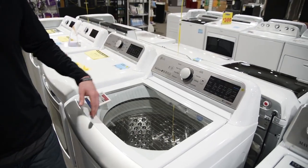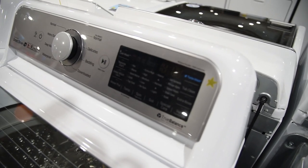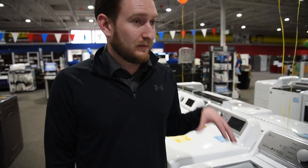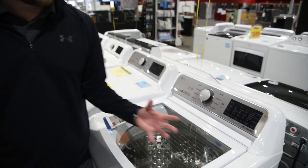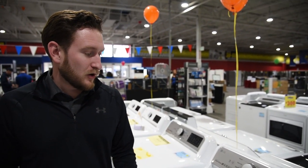Going to the CycleSense TurboWash — a lot of people keep that cycle on. What it does is this unit spins at 950 RPMs. With TurboWash, it's going to use a higher spin speed — not the full spin speed, but a high spin speed combined with higher temperature. What that does is it just gets the clothes cleaner faster, and that's going to help out with your wash times. It also has a cold wash setting, which uses cold water throughout the entire rinse cycle.